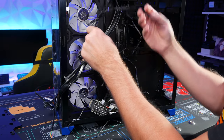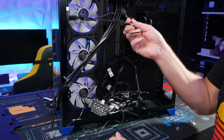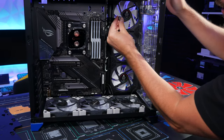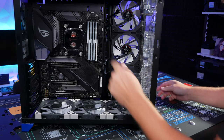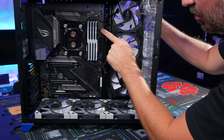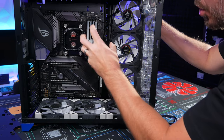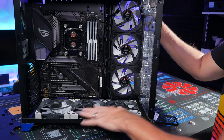Those are tied together, and then all we need to do is bring this to the motherboard header and plug it in. This goes into a five-volt three-pin header for RGB. My motherboard has two — one up here and one at the bottom. The block and distro plug into one header; the fan controller plugs into the other header to control all the fans.